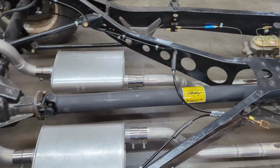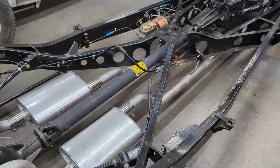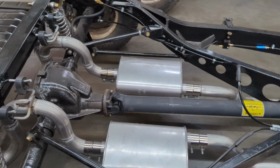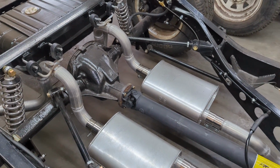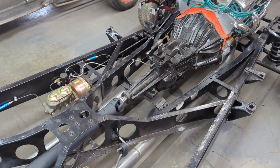The other thing, we finally got the drive shaft in. It took 3 weeks. They don't make them locally anymore. They basically had to send the dimensions and everything away to Toronto. So that came in this morning, so we finally got that in. We've got the nuts on the flange there torqued with Loctite. We have the transmission all filled up with fluid now. The yoke is greased up properly.